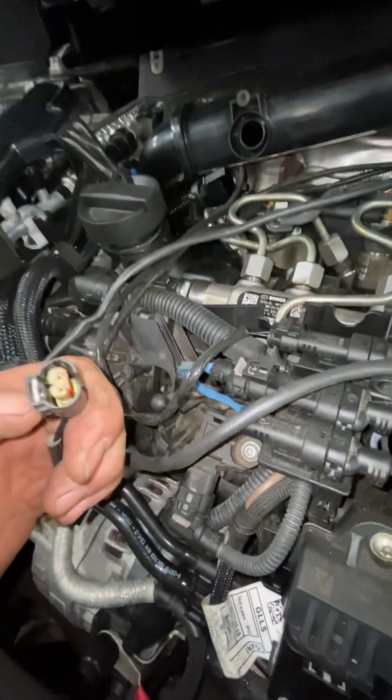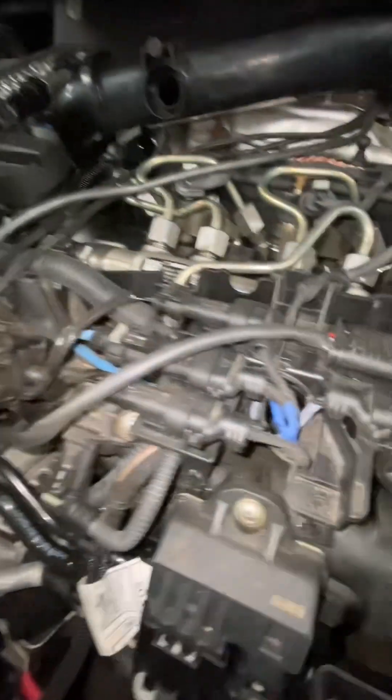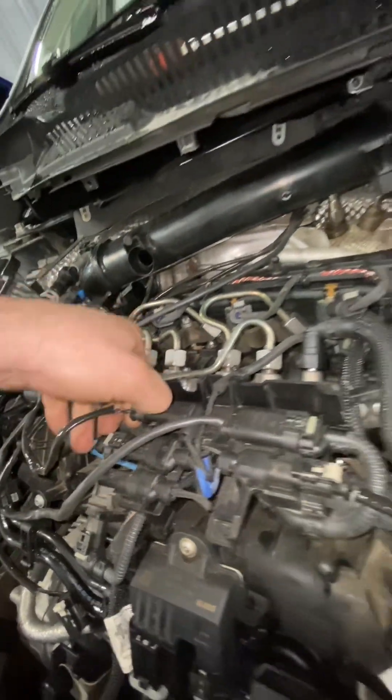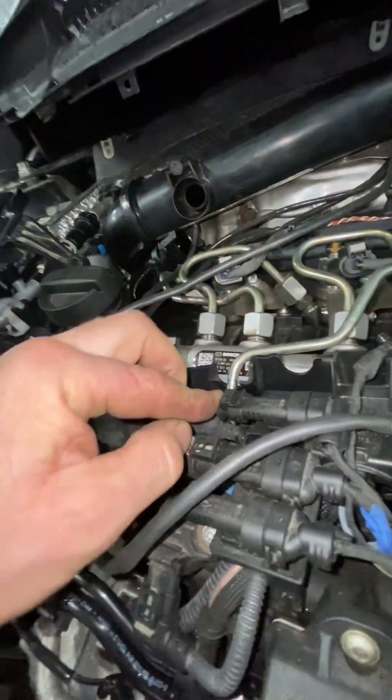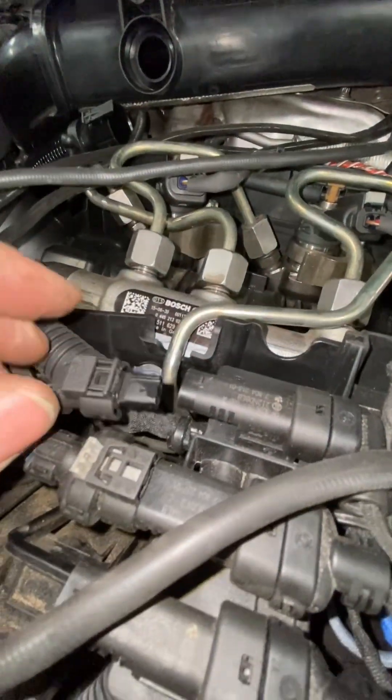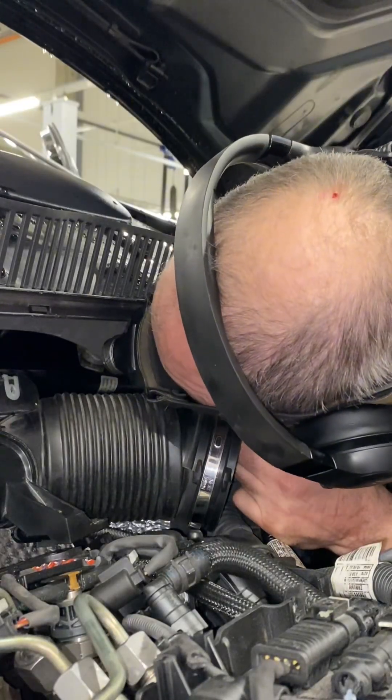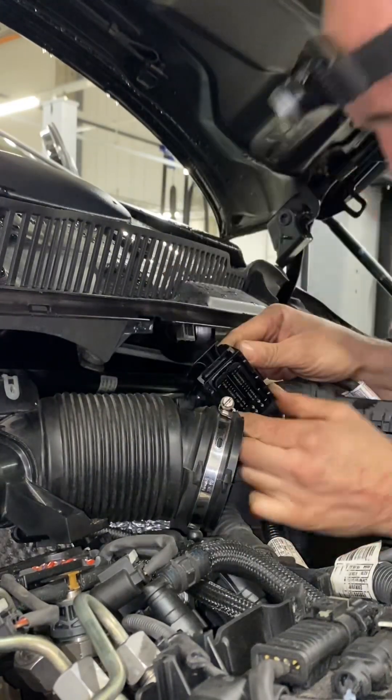There are little signs — for example the dye on that red plug has started to come off. There's another temp sensor here, and look — low and behold, there's diesel. Despite all the advanced diagnostic tools, sniffing the old connectors on the DDE is basically the best way. They've cleaned it extremely well; the large connector can't smell it out, but the small one — you can definitely smell diesel.